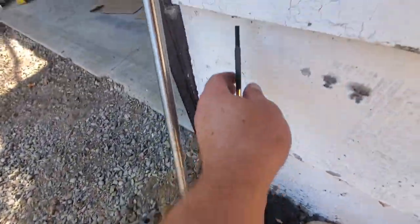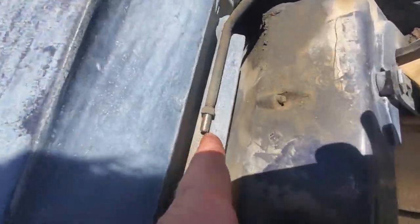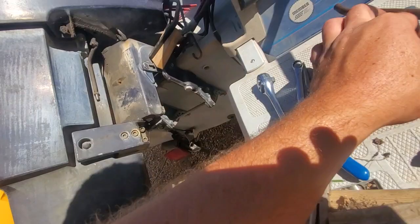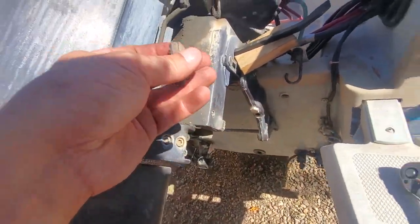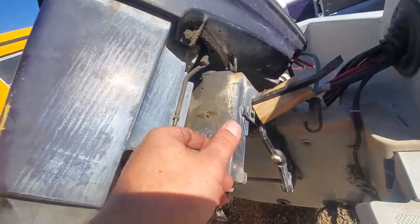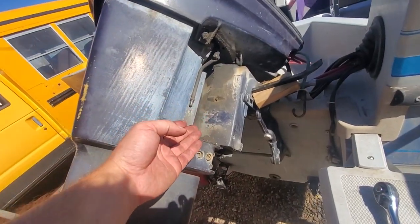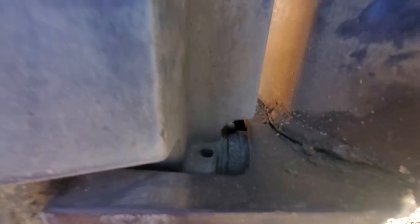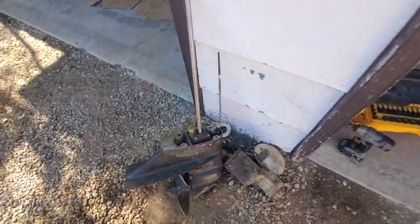You do that, you have to take your sleeve off of that there. That sleeve goes on there — this sleeve right here — and that is to adjust your linkage of course. So I just left the lock nut right where it is, then I loosened that after I dropped the bolts and I just held the leg so I could slide it out. And then of course you've got to make sure everything lines up again when you put it back together. Mainly make sure everything's fitting properly where it should be.